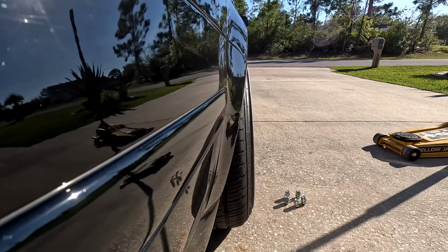All right, that's all the way out. And honestly, like I said, perfect. We want to be just about fender to lip, but not actually touching. Because if this drops, it actually hits that, and eventually you tear up your quarter. That's pretty good. That's a textbook ET perfect, I do say so myself. It's all the way aired out, just about fender to lip, but we're not actually touching, no damage being caused.